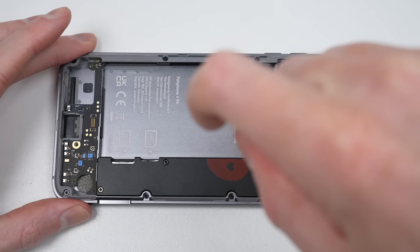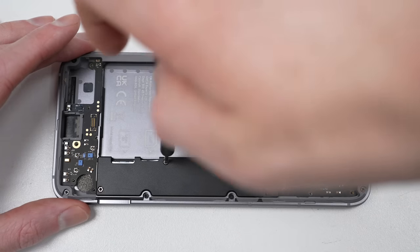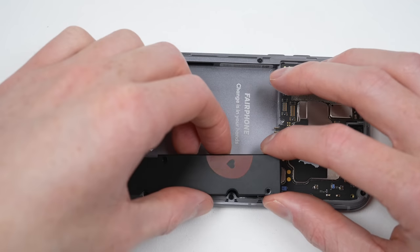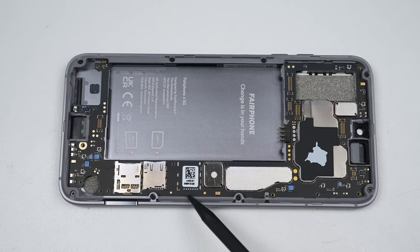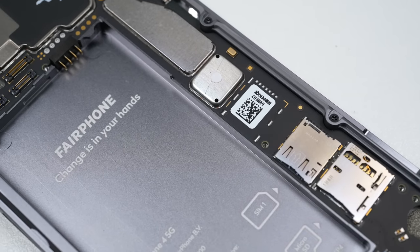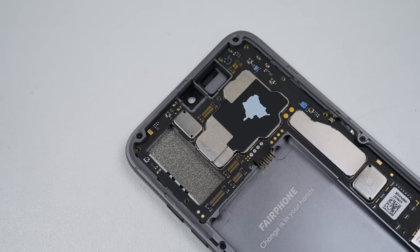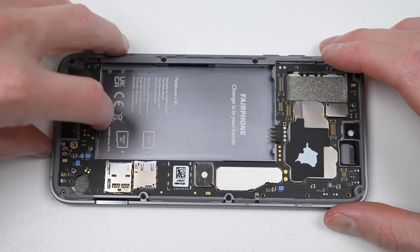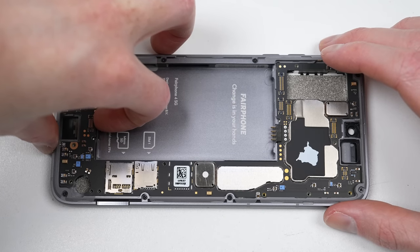The midsection of plastic is secured using Torx screws — this area isn't obviously intended to be removed by the end user, so let's see what's beneath. I've just uncovered another hidden feature: dual SIM capability. The second physical SIM slot is missing, but its solder pads are present. This phone is only available with one SIM and one eSIM, so I wonder if soldering a SIM reader onto it would override the eSIM.